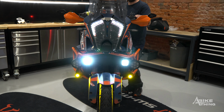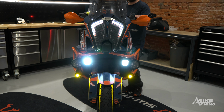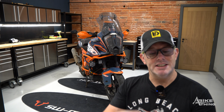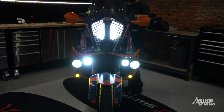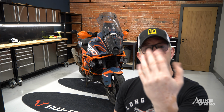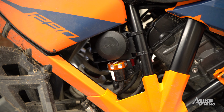The D2s, we set these up as indicators with a DRL. So he wants them on all the time as an amber DRL. So they're set up as indicators. They also are going to take up two circuits. So if you think about it, D7s on one circuit, S4s on two circuits, we've gone to three now, and then D2s on a further two circuits, we're onto five circuits. And then we've got the sound bomb on a sixth circuit.